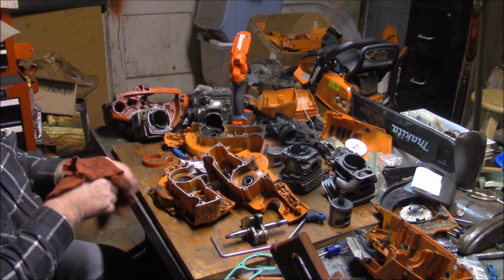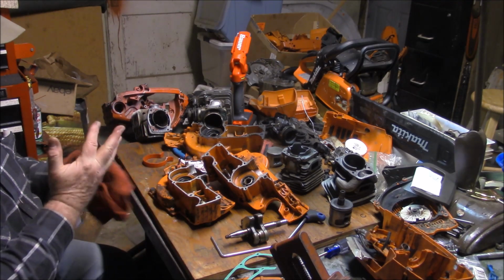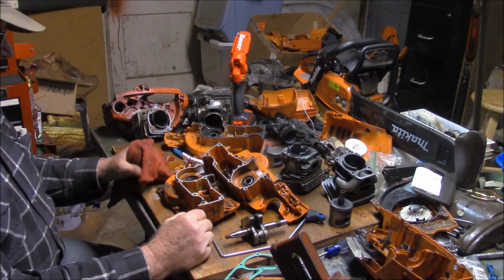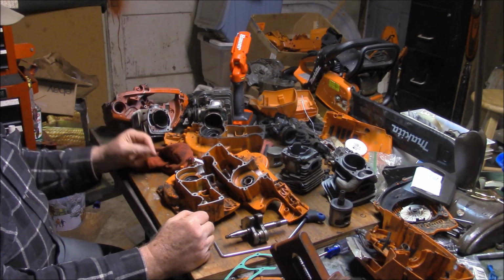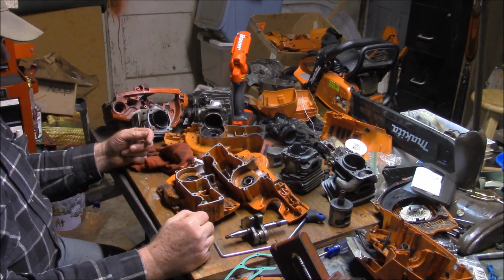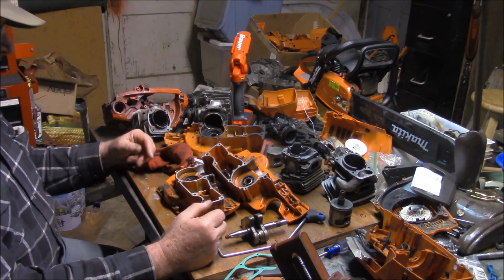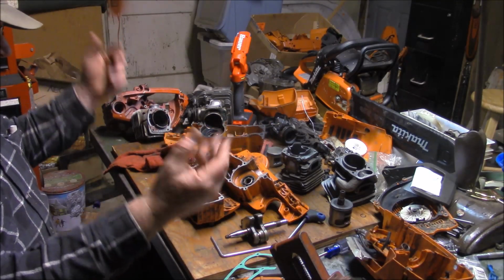And I'm speculating that maybe part of what they were trying to do is reduce the vibration in the bottom end so the things weren't rattling apart. It's possible, right? And then we started having the PTO side bearings fail, and I heard rumor that there was either a bearing installation problem or a machining problem in the case. Well, okay. That would be in addition to. Maybe it was that way all along, which is why they were vibrating apart.